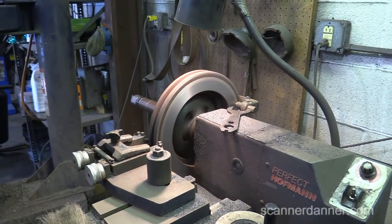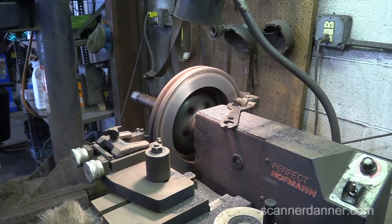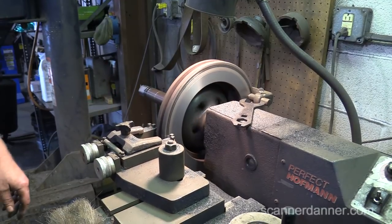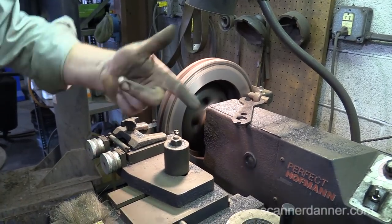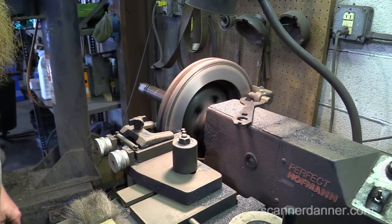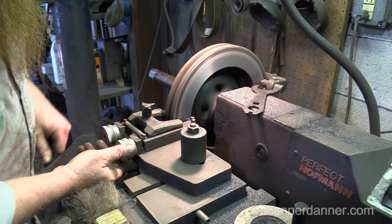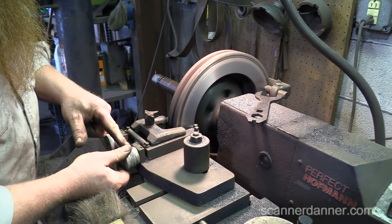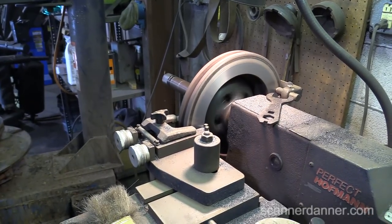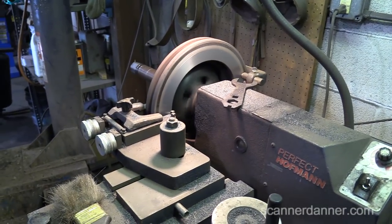It still didn't cut that up. Keep going, man. If I have to replace the rotor, I do. Now you're going to cut 8 thousandths on the inside. And I'm not going to do anything on the outside? Yeah, I'll do that with a finish cut. I'll cut like 2 or 3 off. But like I said, when I set that one up, it will probably cut a thousandth off of this side. I'm going 10 then. Yeah, do it. See what happens. Is this on the fastest cut? Yeah, totally clockwise, it's the fastest cut. All right, cool.